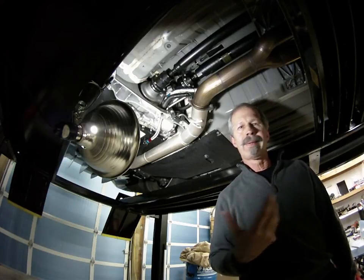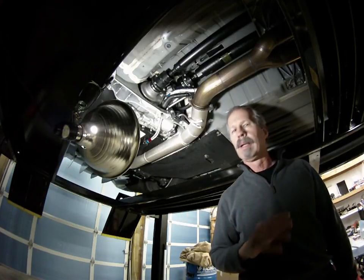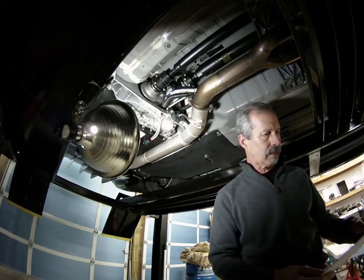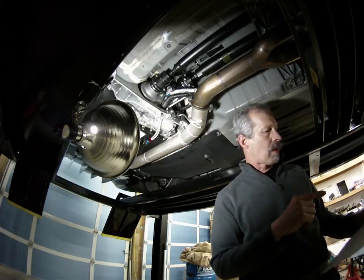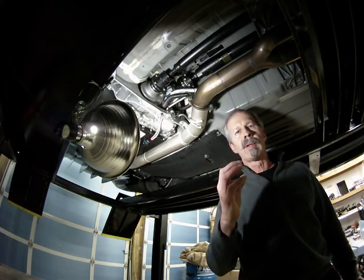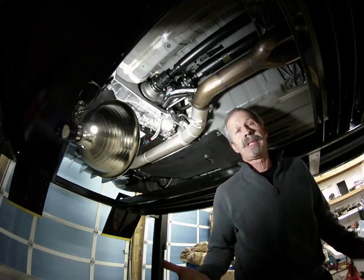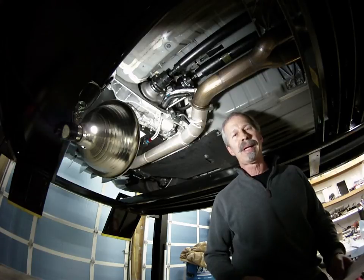A pretty simple system overall. The hardest thing was fabricating the framework for the cooler and the duct. Other than that, it was just little by little getting the operation done. The 8AN fittings and number eight line pump plenty of fluid. One last thing on the pump itself — you're going to need two 8AN to three-eighths straight male connectors that screw into the pump, and then your regular 8AN fittings will screw onto those. If you want to do it yourself, now you know how, and I guarantee this will cool your transmission. Thanks for watching, and I'll talk to you again when I do the next project.